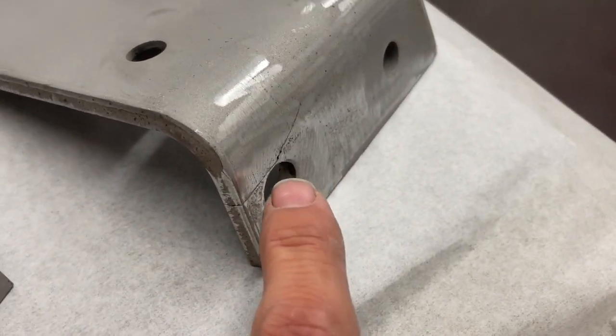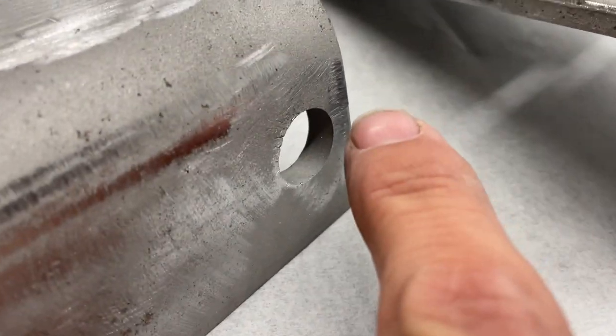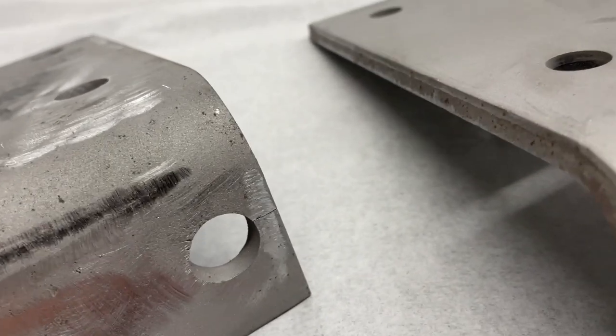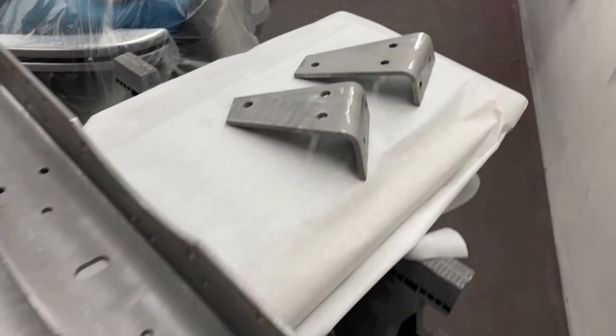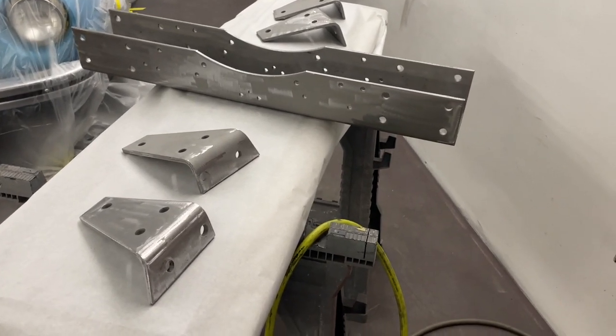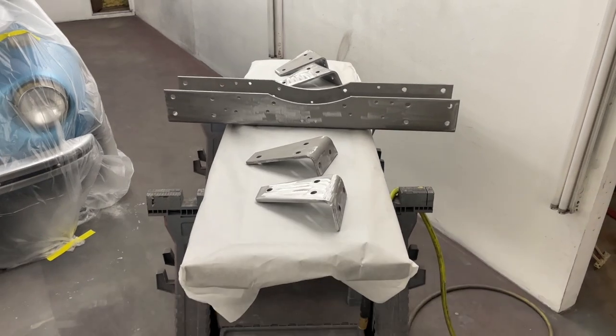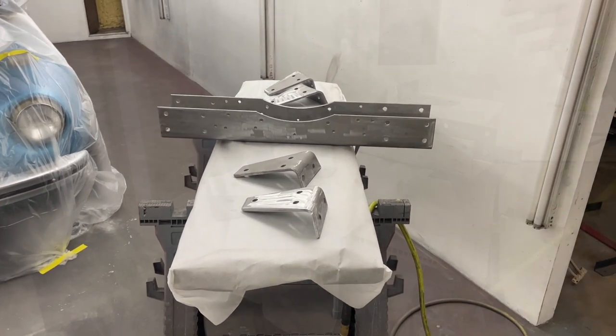That one's probably the worst. They haven't actually separated. There's fatigue cracks. That one's a little bitty right there. So this is why you pull everything off and sandblast them, and get down to base metal, find out what you're working with. So I'll go show you outside what we're also gonna epoxy prime there.